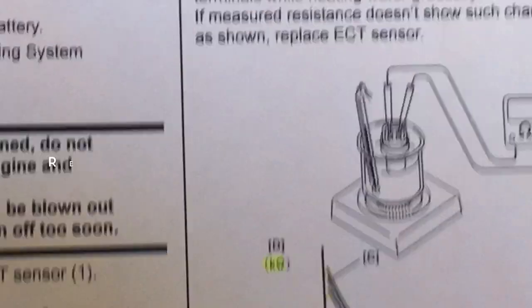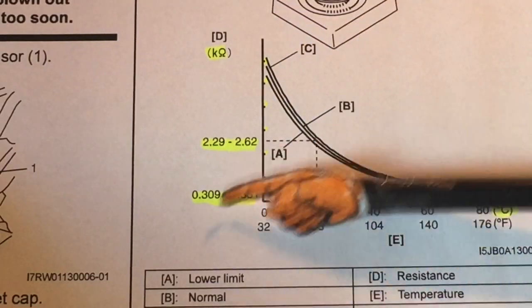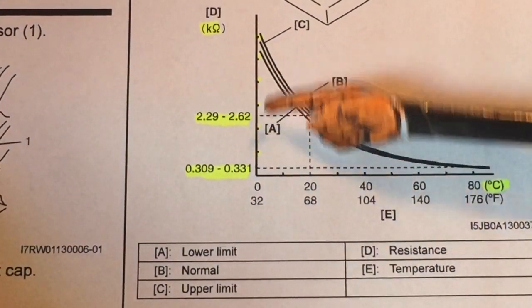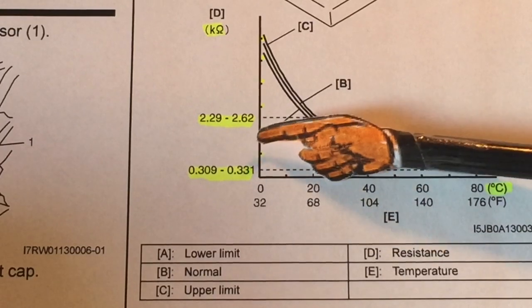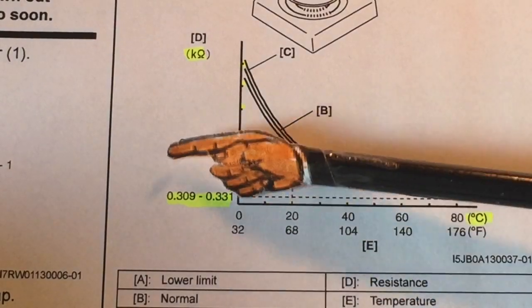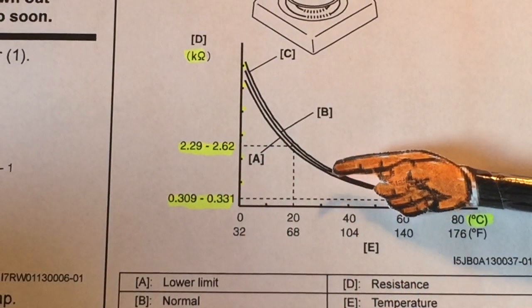Not so uncommon — I think this approach is very standard amongst most manufacturers. In addition, I'd also like to remove the temp sensor from the vehicle and look at it against the graph. The graph gives you reference points for temperature versus resistance on the sensor itself. Through the use of the decade box, we can go across the two pins on the sensor plug and plug in these values, and we'll see if we can get the respective 80 degrees and 20 degrees Celsius by stepping through a few values.